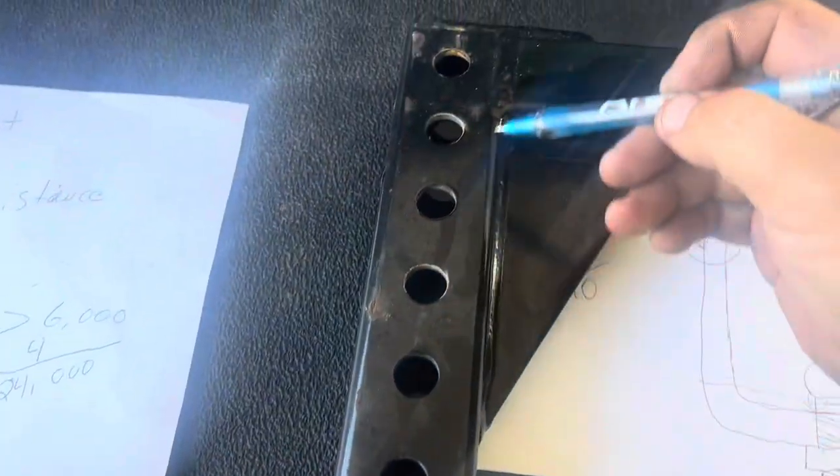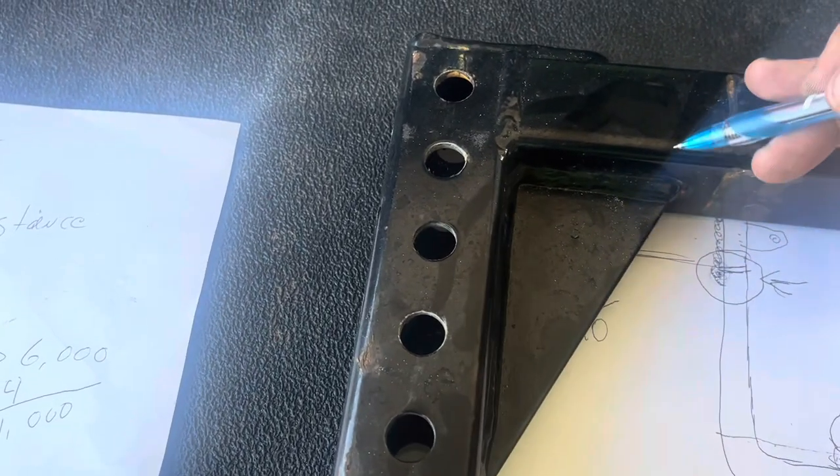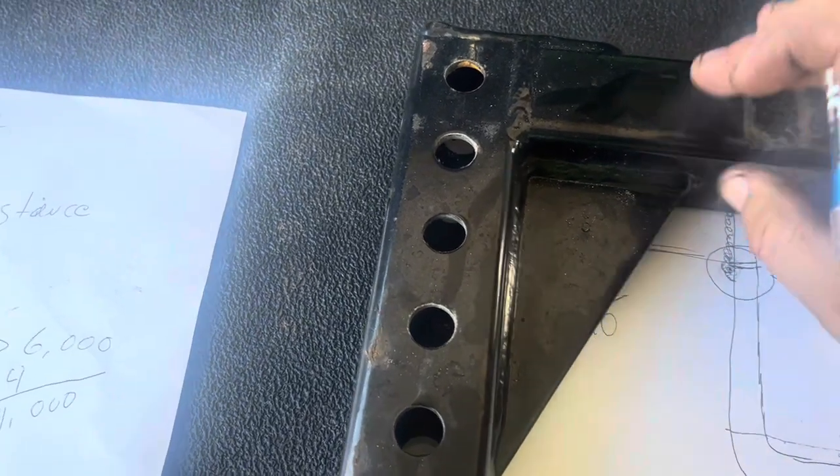I'm willing to bet he put more than 6,000 pounds of pressure on that ball when trying to yank out a 9,000-pound diesel that was stuck. This is exactly why ball hitches fail — it's the lever action of the hitch design. We're not talking about the ball itself, which is in single shear. I've only seen one ball fail in 15 years and about 20 hitches fail, because the force is multiplied through the lever, always breaking at the main shaft. Even with a gusset, you're just moving the stress point — it's still going to break right there.